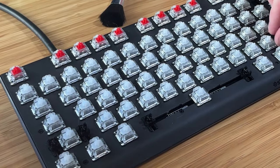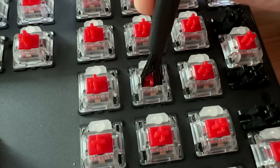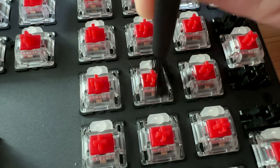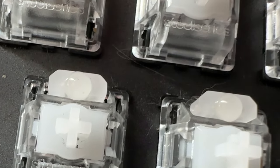I got frustrated with Q-tip fibers when cleaning my own keyboard, but by also using a microfiber towel and some air duster, I was able to easily get rid of all of them. If you have some sticky keys, you may want to brush inside the switches a little bit — this fixed a couple keys on my keyboard that had been sticking since a drink spill a couple months ago. If your keys are still sticking after using this method, you'll have to remove the screws around the keyboard and remove the entire front plate for an even more thorough cleaning. If you want to remove as many hairs as possible from in and around your switches, grab a pair of tweezers to easily pull them out. You can spend as much time on this as you'd like, but beware — there is always another hair.